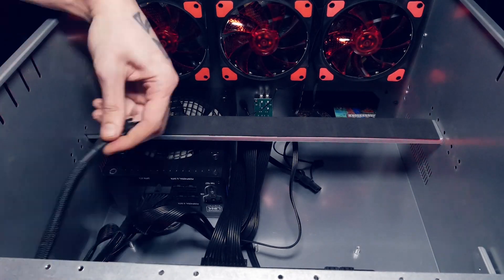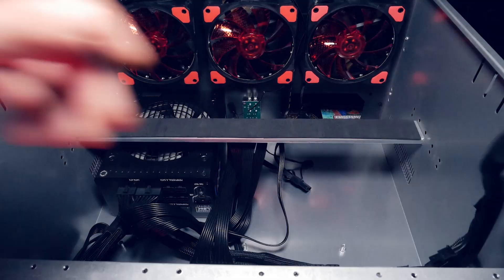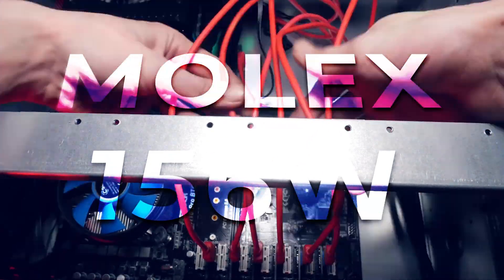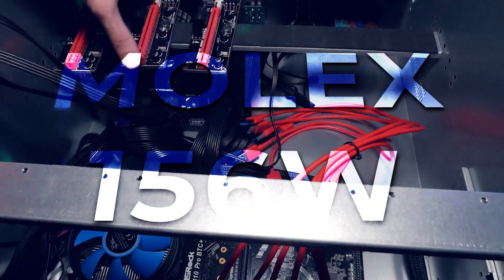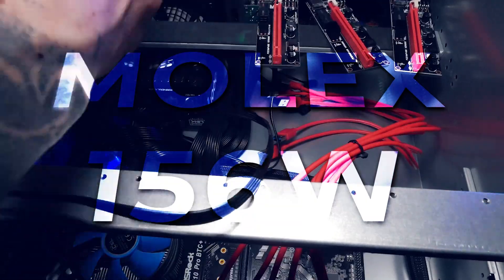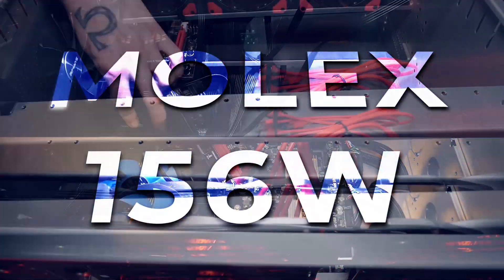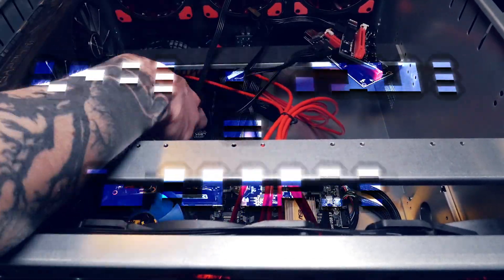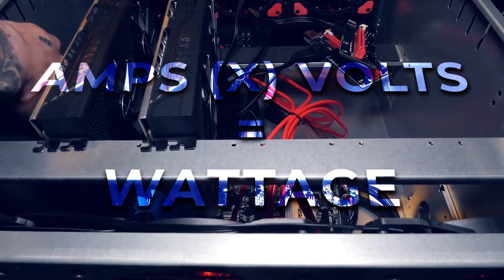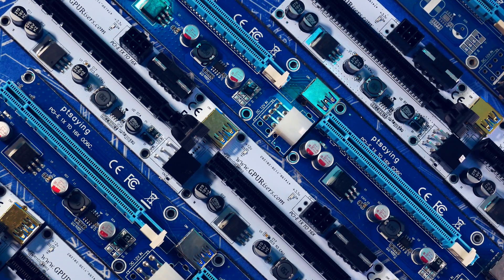Let's talk Molex first. These differ, and I would be careful with older PSUs — definitely do a Google search on your PSU brand if you're not sure. But modern Molex, the whole lane (not just the connector), can provide 156 watts. So for example, on my Corsair ATX PSUs, I feel safe powering two risers per one Molex cable. A two-Molex to one six-pin adapter is also fine to power a riser, but I would not power more than one riser from that lane. Check your PSU model and manufacturer for how high the Molex lanes are rated. The formula to calculate is: amps times volts equals watts — with this you can calculate each and every cable.